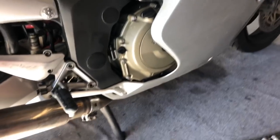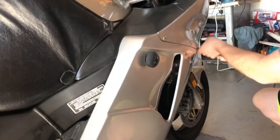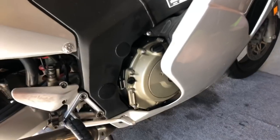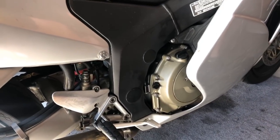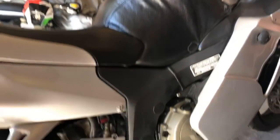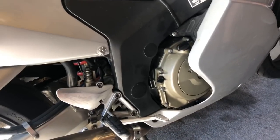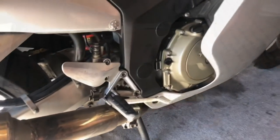The majority of bikes have the clutch on the right-hand side. On this one it's under this cover, so we've got to take the side cover off. We're also going to be draining the oil. I think I may have shown in one video a way that you can sneak that by — if you want to lean the motorcycle heavily over to the left. I'll do that on dirt bikes but generally won't do that on a street bike. We're just going to drain the oil and get this lower fairing off.